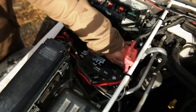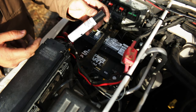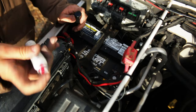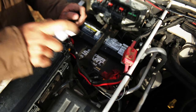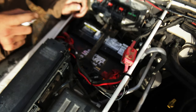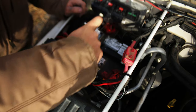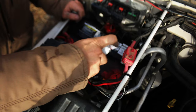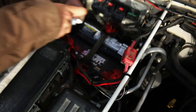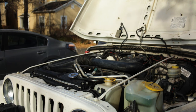Okay, we're all tightened down and good to go. The battery is nice and secure — so much better than that wedge. We have one last thing to do and that's battery terminal protecting spray. I put this on every vehicle I own. This is an AGM battery so you really shouldn't have any corrosion, but it'll just help protect the terminals and keep everything nice, so when I come back to it in a few years I don't have to clean up corrosion. Okay, there we go — I think we're done. Let's see if this thing starts.